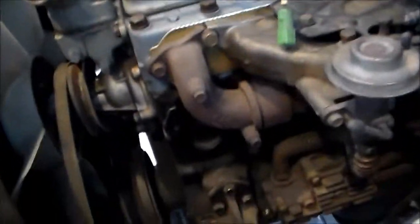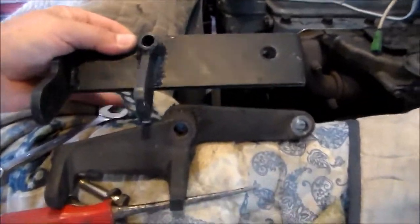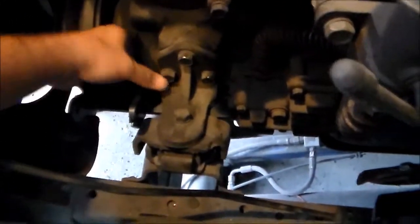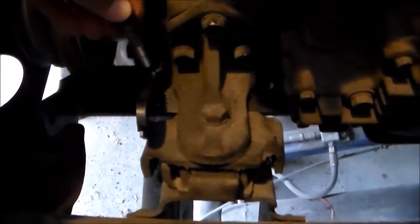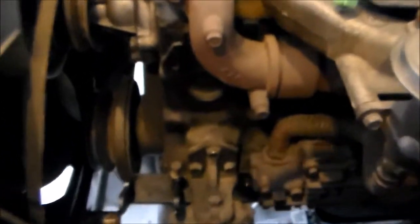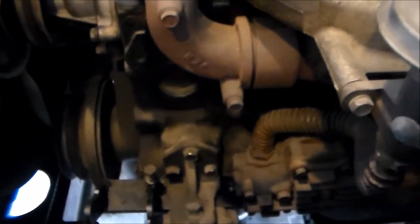Sometimes you get this stuff and there's little or no instruction. So here's my old bracket and here's my new bracket — it just does the same thing in a slightly different position. You've got to wiggle it around down here to get it into position. It snugs up and mounts right there. The two bolts that you took out go right back in the original location — sock those down, and then you'll be able to set the pump on there and work on getting the adjustment bracket, belt, and things of that nature going.